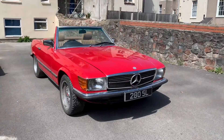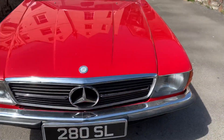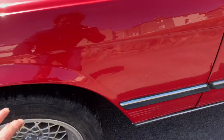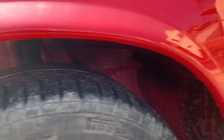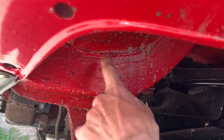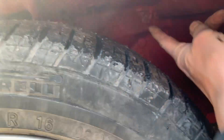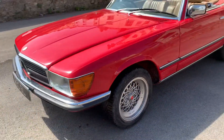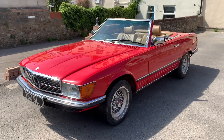You may be one of the very few people who own a rust-free SL, but most people will at some stage have to deal with rust issues. One of the common rust areas on these cars is the frame rails here, and I'm going to do a short video today on the ways of repairing these. You've basically got two choices: you can either use butt welds or lap welds, and I'm going to show you the problem of doing it the quick and easy way.